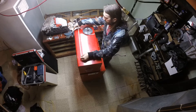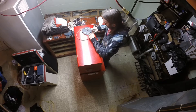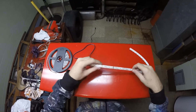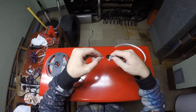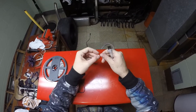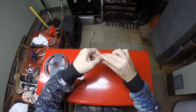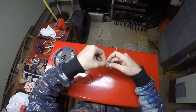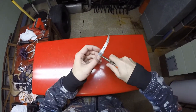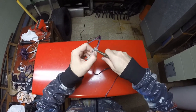I start first by cutting two sections of LED strip about two feet long. You could be more precise and actually measure the width of your footwells if you want — I just didn't feel it was necessary. Next, you're going to have to attach a wire connector onto the LED strip. It's pretty straightforward: you just push the strip all the way in and then close the latch. The connector will pierce the strip, creating contact. Then take your LED wire, separate the four wires from each other about an inch, and put them into the connector. I recommend using pliers to close the latch — they can be kind of rough on the fingers. Then it's just a matter of repeating the same process a few times and then you'll have yourself an LED harness.